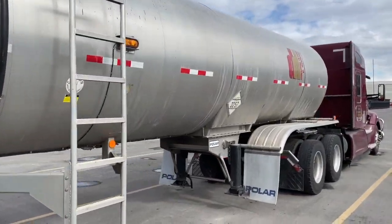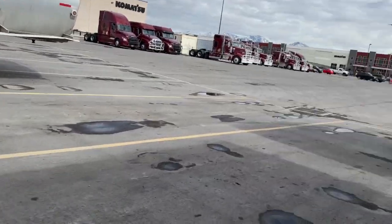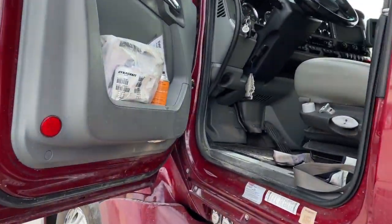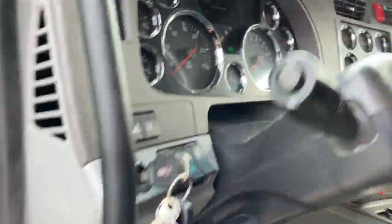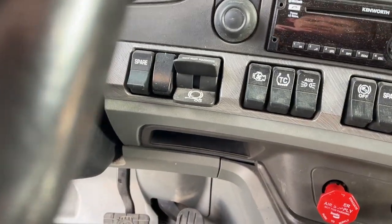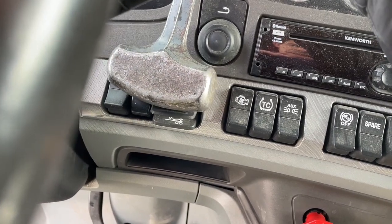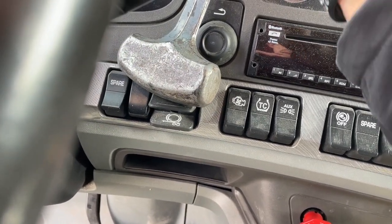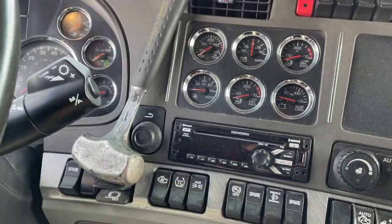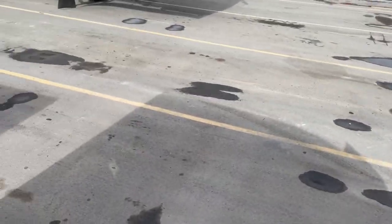I can see my front marker lights are on. I haven't checked all the lights yet though — what about my brake lights? That can be a little challenging because you've got to have your brakes on. The trick for that: I'm going to turn off these lights and in this Kenworth I'll use my hammer to push down on the brake pedal so my brake lights will come on. Some trucks like a Freightliner have a thing you pull down on — you can do the same thing, or use a bungee to hook around it and pull down on it.